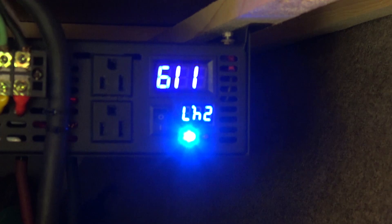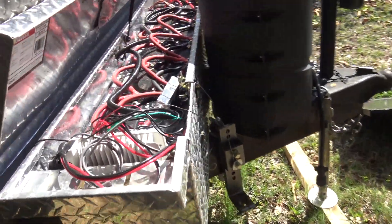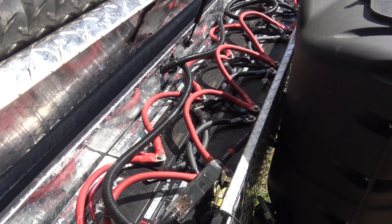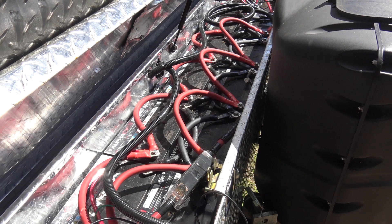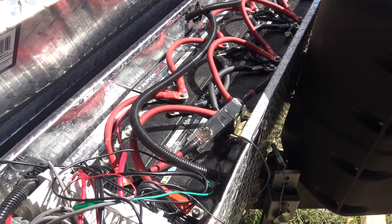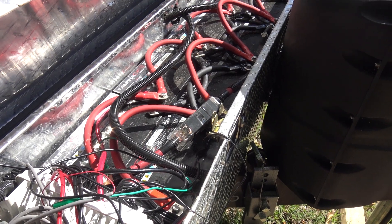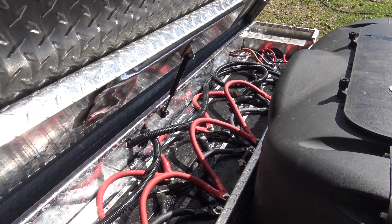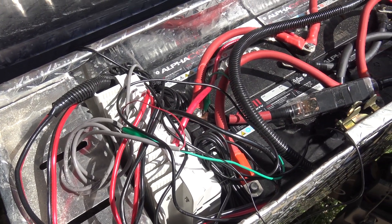It's still at 24.7 — 24.67. Again, that's because we're after 3 o'clock in the afternoon. The solar is probably charging about 23 to 25 amps. In the height of the day, today at 12:30, 1 o'clock, I was charging while the batteries were being used — going up 0.1 volts every 5 to 10 minutes with the 15,000 BTU AC running, both TVs, the refrigerator, laptop chargers, phone chargers and stuff.